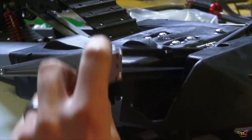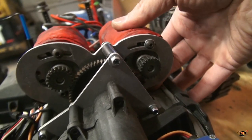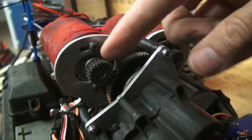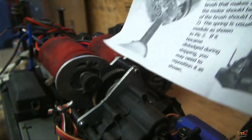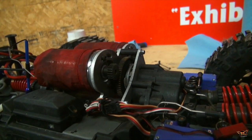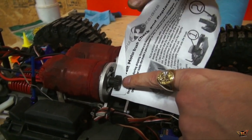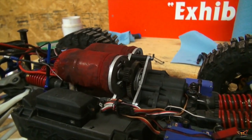How's the flex up and down? You're good, that'll do. Some people have never seen motor mounts like this or never thought about why there's grooves in there. This is to help set your gap between the pinion and the spur. You just make sure your lower bolt is loose and your upper bolt is able to move. Now normally I'd just use a piece of paper and get it in there. A lot of people use business cards - depends on what kind of gap you need to set. That kind of gives me the right amount of room so that the pinion is not gouging into the spur. I'd want to be tightening that up before moving anything, but that way we've got a nice mesh.